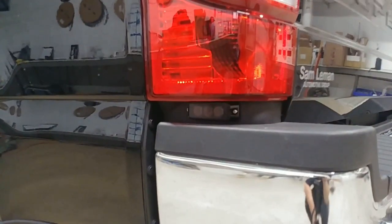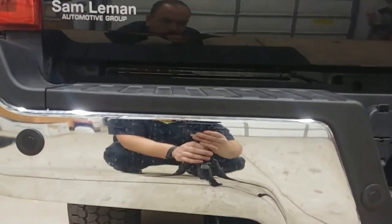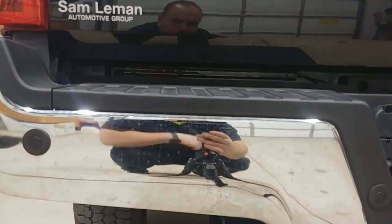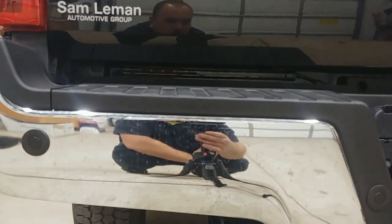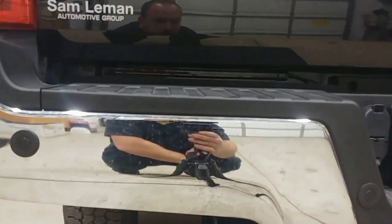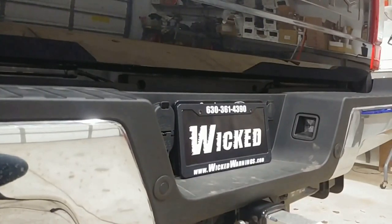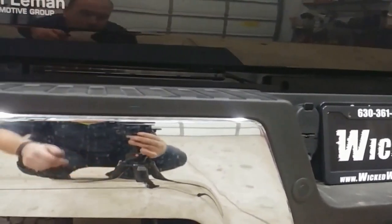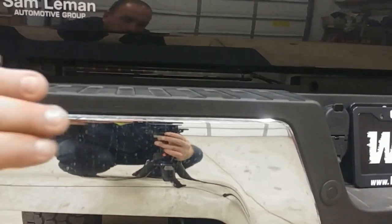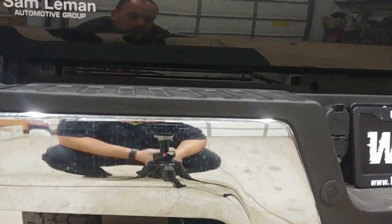There are your Thin-X strips mounted right under the tailgate. I usually try to go just above the plastic bumper edge, and honestly I sit on the floor when I mount them and sight them perfectly with the tailgate, then step back about 50 feet and look at it a couple dozen times to make sure it's straight. Once I'm happy with it, I set the VHB by pushing down hard for a count of about 90 seconds. That's important with VHB — not only do you want to prime it, but firm pressure for 90 seconds makes a big, big difference.